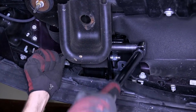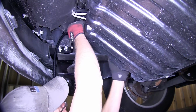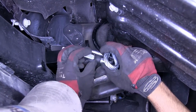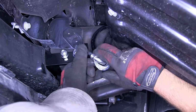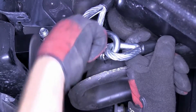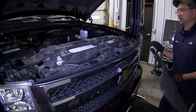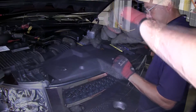Now with both base plates installed and torqued to specifications, we'll need to install the safety cables and D-rings. The safety cable will go around the frame and back to the chain hold down and be secured with the D-link. Now with that done, we'll need to only reinstall our plastic cover we removed previously, and this will complete the installation of the Blue Ox baseplate kit.